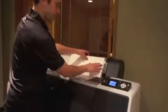You want to make sure that the paper goes all the way through the platen so that the print head can see it when it loads up. Once the paper is in place, go ahead and close the platen again. You're going to hear it close, and it's going to ask you to press the pause button, and it's going to start to load the media.